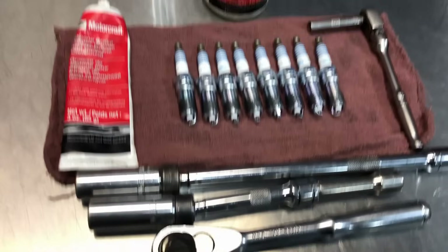Before we get started, a few notes on this engine: Ford now wants the engine warm when changing spark plugs — not cold like they used to say, and of course never hot. In summer, just start it and let it idle for about a minute; in winter, let it run two to three minutes. You want to bring it up to around 100 degrees — that's best for pulling spark plugs out problem-free so they don't get stuck or break. Also have compressed air on hand to clean around the coils, as they trap dirt, though not as badly as other modular engines.